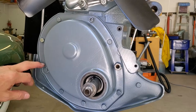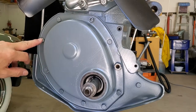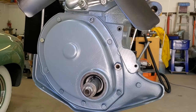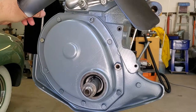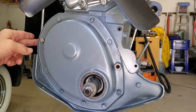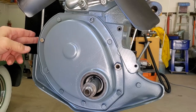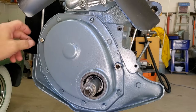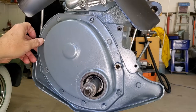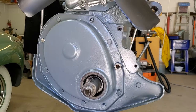A couple of other things to note: we had a washer under this one because of the hole size. This one here is a modification from original — we run the fuel line up through the air duct to help keep it cool. We use a rubber mount bracket here, like you can get in a hardware store. Yes, this is a modern solution. We put it on this bolt and tighten it up there. That's our fuel line in a non-standard location, but it's worked great for the last 20-some years, so that's the way I'd suggest running it.